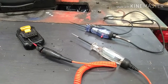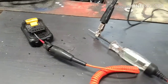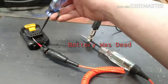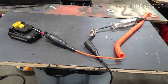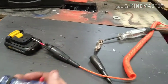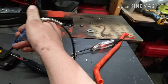You might be wondering — I know how a test light works, so what is the point? Here's why: I hook the incandescent test light up in series. I'm using a little drill battery — it provides 12 volts, so it works fair enough for this demonstration. This is hooked up to battery plus and that's battery ground. It's going to go through the incandescent test light first and then through the LED test light back to ground. What will happen? Only the LED test light lights up, not the incandescent one.